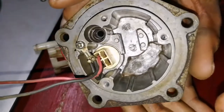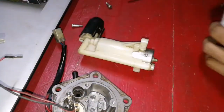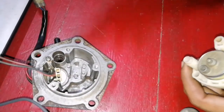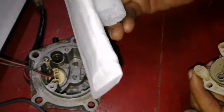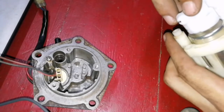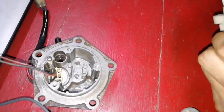It's now completely clean and ready for the new filter. Install the new fuel pump filter properly on the fuel pump and just press it hard — push it until it touches the fuel pump body.